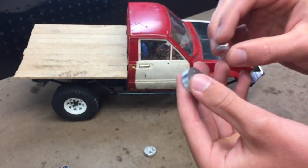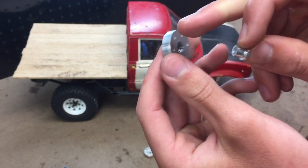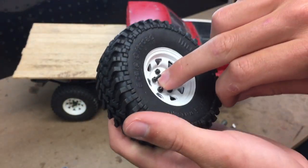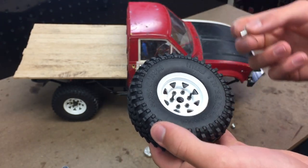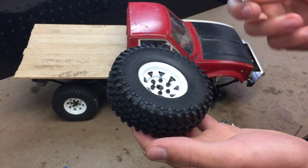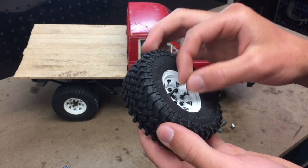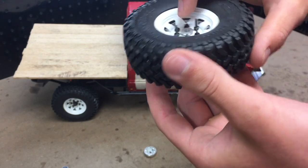There's another piece that comes along with these parts — the spacer. What this does is make up for the gap between the bearing in the back and the wheel that goes on top. If you were to tighten a wheel nut down right now, it would put the clamping force on the face of the wheel, which is not what we want — over time the wheel could spin and loosen the wheel nut, or the nut could prevent the wheel from turning if it were on a locked axle shaft.